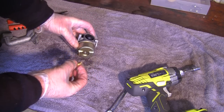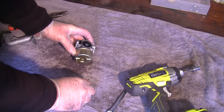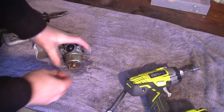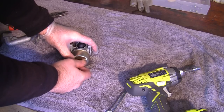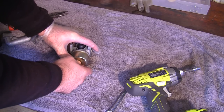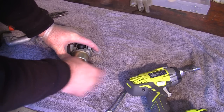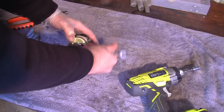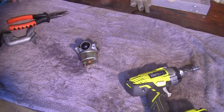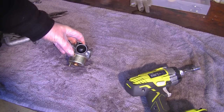Now this is critical, this is super important, because if you want to buy one of these parts, I reckon these are at least a tenner and you probably won't find one at the minute on eBay. So when you go to put this back together, this is the most important part you can get right. Make sure you just do this finger tight, and you can't go slowly enough doing this. Make sure that it's actually threaded perfectly and there's no resistance on the thread, and you get this back in like this. And then without overdoing it, get a spanner. We'll just take this and I'm just going to nip this up. You don't want this too tight, that will do. Any more than that and you risk stripping this thread and breaking this little gasket under here, this little seal that stops the fuel flowing.